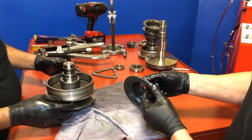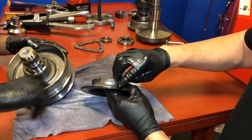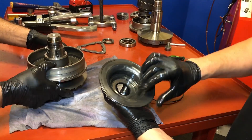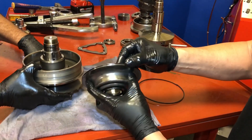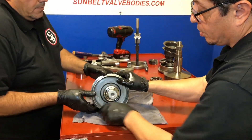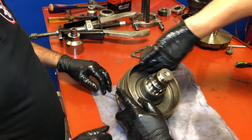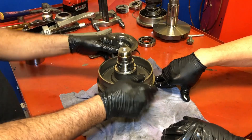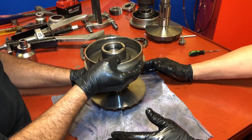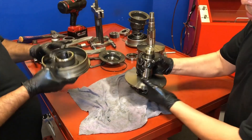So on this one here, this is another piston. Same thing — we're going to look and make sure the ring is in good shape, make sure that where it meets at its sealing point they meet together. Also let's make sure it's not worn out inside here, not touching and wearing itself out. We've got to make sure that the lips are in good shape and they're not bent or damaged. This one looks okay — we'll get a new ring in there. On this part here, similar — you can see where the piston rides. You want it to not be scarred or scratched up in any way. It actually looks really good, so we would go ahead and use that one again.